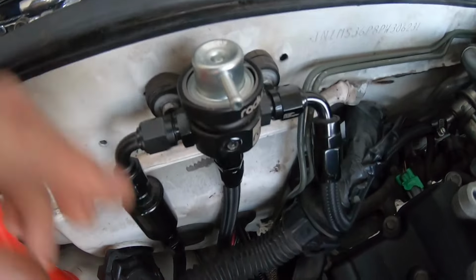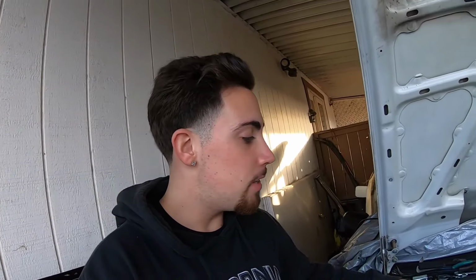The body was okay. But the regulator up top, the one that came with this, was for an E46 BMW. The E46 BMW regulator, the bottom piece is skinnier than this one. The one that I'm using now is from an Audi A4. So Radium, their previous body of fuel pressure regulators, used the E46 style regulator, but they had recently switched over to the Audi style and we were unaware of that when we put it in. I got all of this from Hexa and Hexa was unaware that they had changed the style over to the Audi style regulator. Once we figured that out, I swapped it over to this one, as you guys saw, and it fired right up.